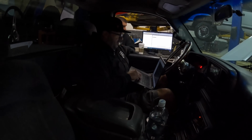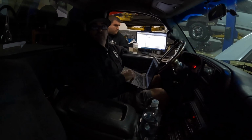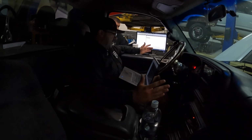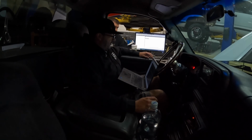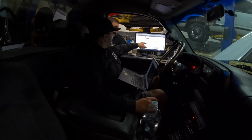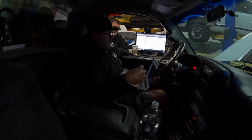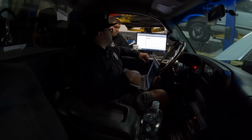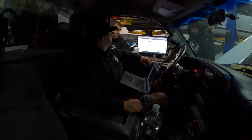The motor is fine. There's nothing on the engine side that looks off. It all looks smooth. Both banks look fine. The air fuel is good. That was 11.5 AFR, 14.5 degrees of timing. But something is happening, and I could feel it. It feels like drivetrain. It feels like transmission or diff, that's why I was checking the tires, because you could feel it unload and reload. Yeah, that's how it kind of feels.